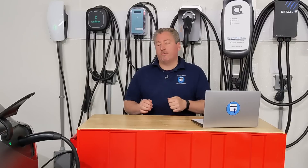Let's take a look at how the 2021 Model 3 compared to my 2019 Model 3 when I did the supercharging recording last year. A couple of things to mention: the 2019 was a year old and had about 15,000 miles on it, so the battery already had some degradation — more so than my 2021, which only has about 5,500 miles on it. We did notice the charging curves are different, and I kind of expected this because I heard Tesla did some massaging of the DC fast charge curve.